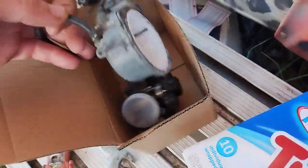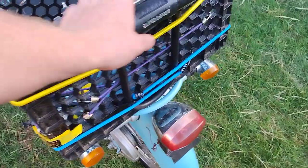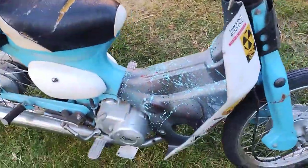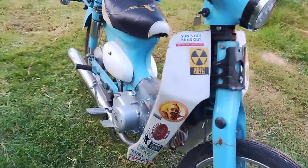I'm out here by my camper — that's the carburetor right there. I ended up losing a jet in the grass somewhere, and I couldn't get it unclogged with the materials I had anyway. So I shelled out $14 for a new carburetor and the thing fired right up. Unfortunately I got a carburetor that's one millimeter too small, so at around 50 mph it starts to bog out.